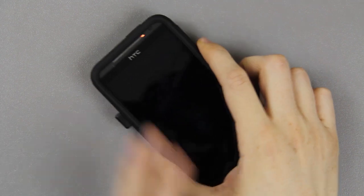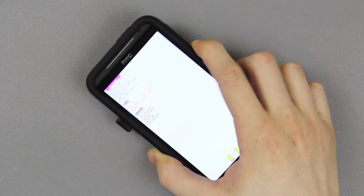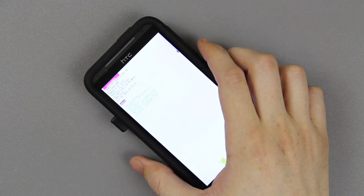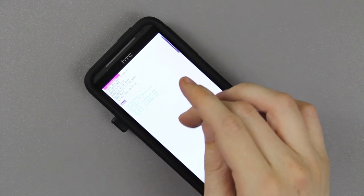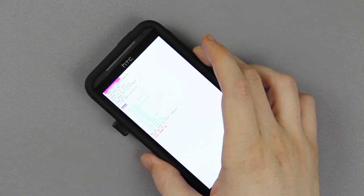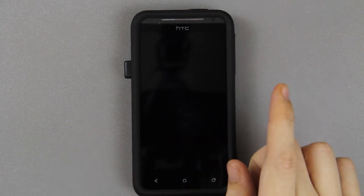So — you backed up your apps with Titanium Backup, you installed the very latest recovery, and you downloaded the ROMs from the thread that I'll link in the description. Huge shout-out to XHoss for putting this together. Viperboy also has a thread for the Deodexed version if you want that. Hold down volume down and the power button again, let go of power, keep holding volume down. Then press volume down once and press power to go to recovery. But first I need to delete that PJ file or it's going to keep trying to flash it from the bootloader.